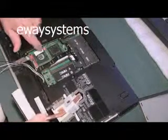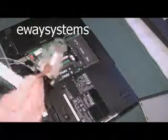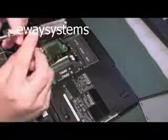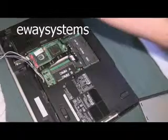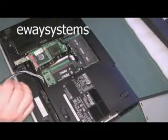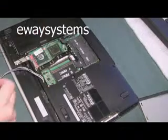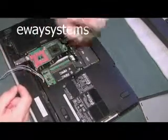There's the CPU and that's probably the graphics card — I'm not sure. Let's just put this off to the side and we'll also take this opportunity before we put it back in to clean all the dust out of here. Let's get that processor out too — just put a flathead screwdriver in, you twist the unlocking feature there, and now the processor will pop right out. Put it into a safe anti-static spot.